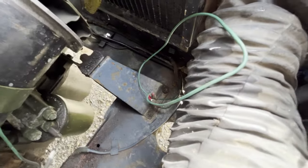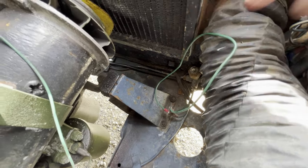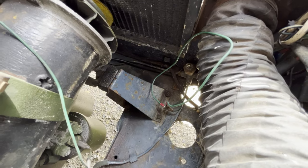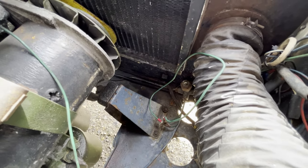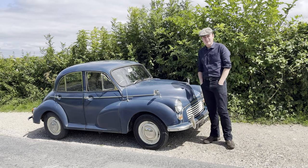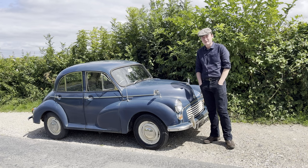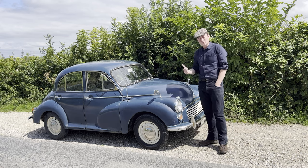That does mean I've now got to get a new switch. When I take it out I'll break into the brake system and have to bleed the brakes — well, I suppose I needed to bleed the brakes anyway. That's another one to add to the shopping list. The old thing is starting to develop a few faults — that's what you've got to expect when you're driving old cars a lot. I've got rear drop links for the dampers on order because I can hear knocking from the back.